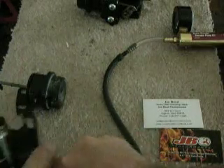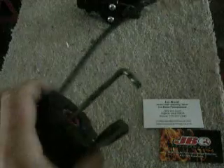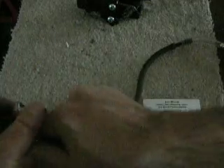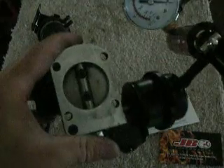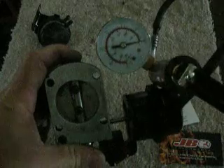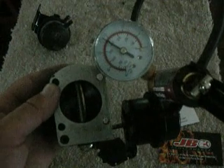I'm going to show you how a good one will work. So you can sit here and watch this lever — I'm up to 15 and it stays there. And that's how a good working valve should be. I'm going to show you how it works on a car. This is that Whipple unit I have. I just want you to be able to see what's really going on here. We're going to draw a vacuum, and you can see what's going to happen to this butterfly. It has to hold that vacuum there to be functionally proper.